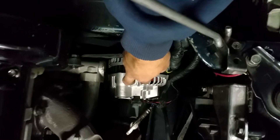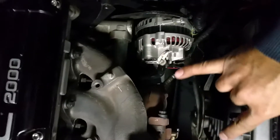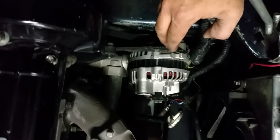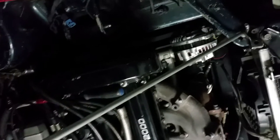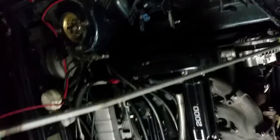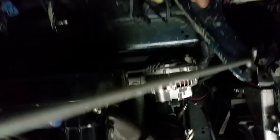Also, zip tie technician — because this is a Mitsubishi. What's really weird: I've burnt through so many alternators by not disconnecting the battery while working on it, and then a wrench always finds a way to arc that positive lead off the alternator. So always disconnect your battery whenever you're working on the car, because it's like magnetically attracted to wrenches. And once it's arced, your alternator's dead — you might as well go replace it.